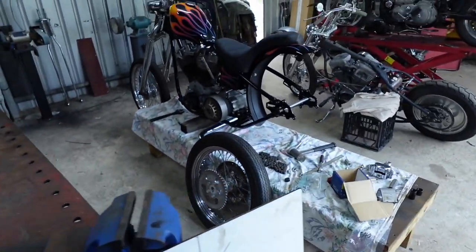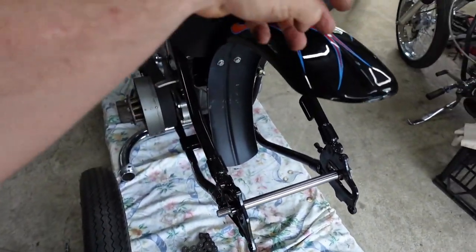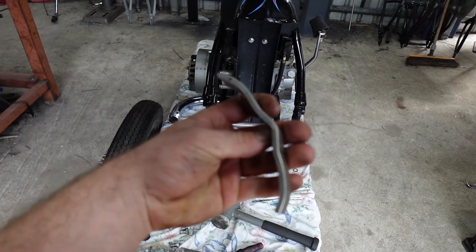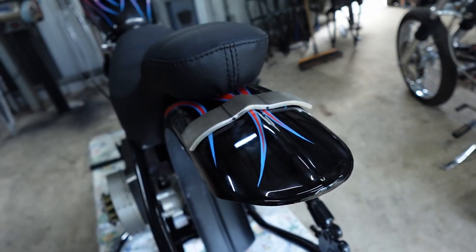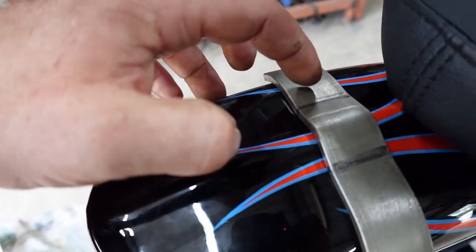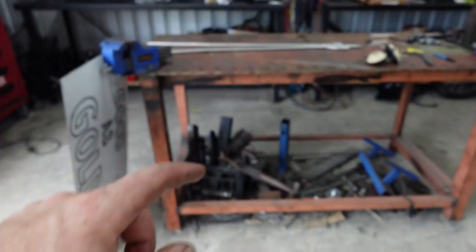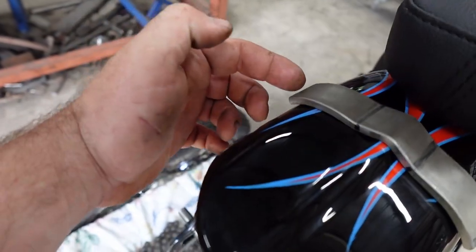And then I'm gonna weld the little tabs on where the bolt goes through and then sit it on there. And then I press start. Where is it? Here. I pressed up this little bit of steel that is gonna be the guard support. So it's gonna sit on there like that. As you can see, it fits pretty well. So I'm just gonna do a bolt here, like bolt here. And I'm gonna cut it down, make it thinner, make it the thickness of that round bar. But that's that piece I've got. And then that'll just weld just there and there straight onto the round bar.